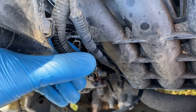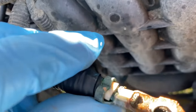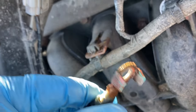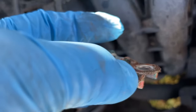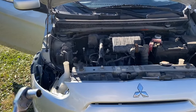Okay, so I removed that nut — see, the cable just comes off. When you put your new alternator back on, see all that rust? Get some sandpaper and clean all that rust off so it's nice bare metal for a good connection. There shouldn't be any rust on it for a proper connection. Okay, moving on.